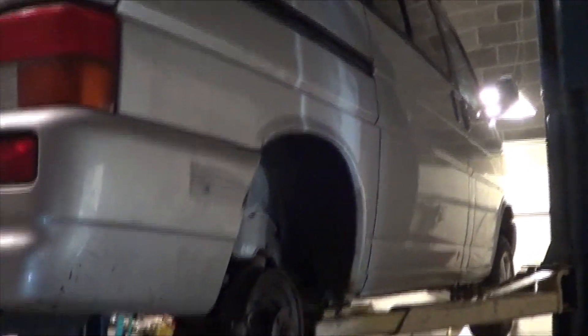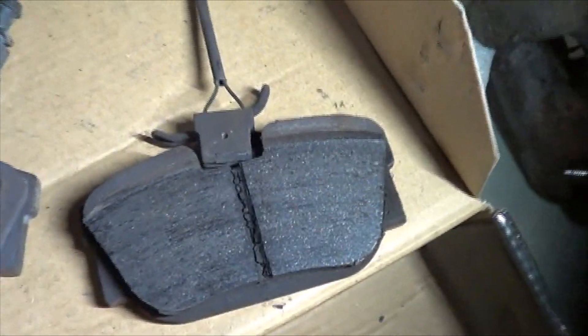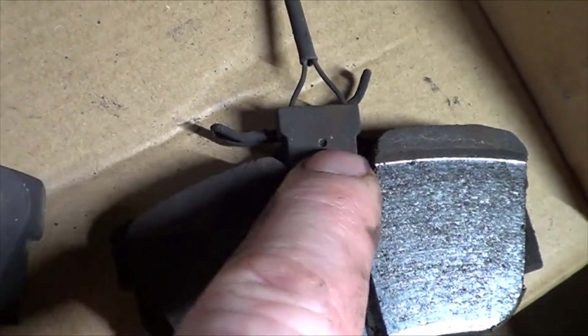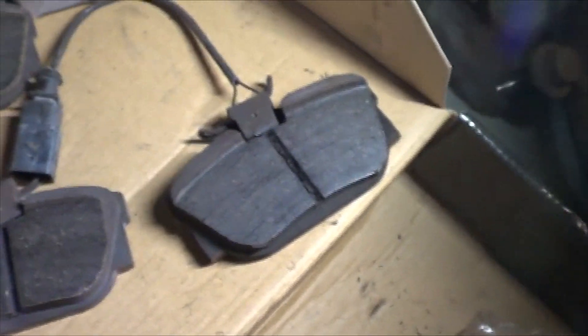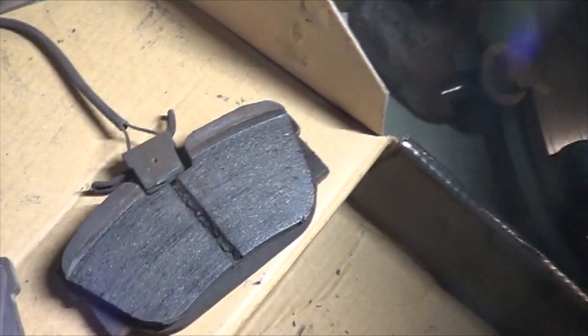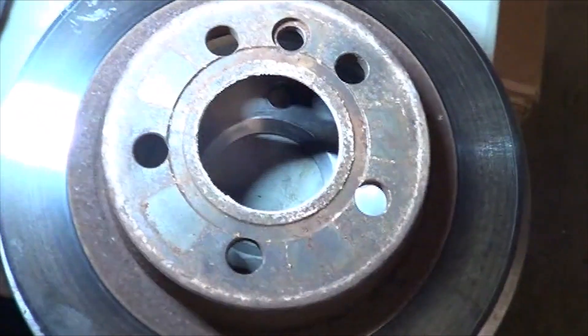We are working on a 2002 Volkswagen Eurovan and we're doing some brake work on it. The brake warning light was on, and you can see here on the front pad it's wearing into the sensor right there. The rear on this car also has sensors, and if you notice, there's an unusual step in the brake pad — it is rubbing the wear sensor, not worn through it. This customer has noticed he goes through brakes in the back really fast, and it rubs into the sensor and will eventually cut it much sooner than it should. The reason why is because this vehicle has 16-inch wheels and it's got the rotors on it for 15-inch wheels — the rotors are a different size.